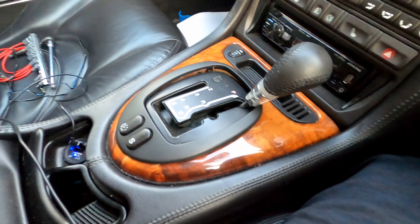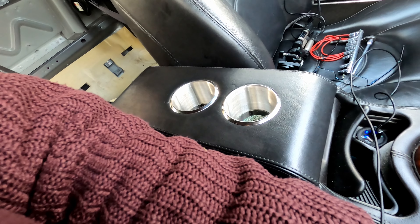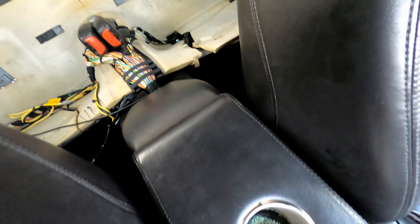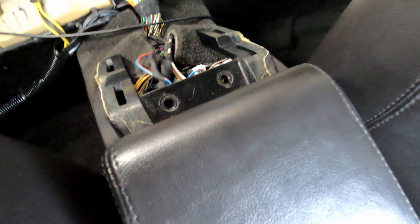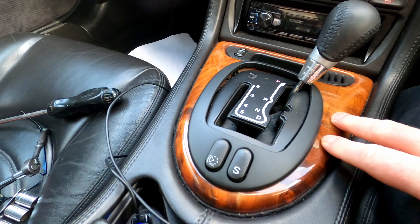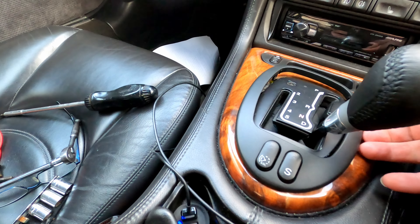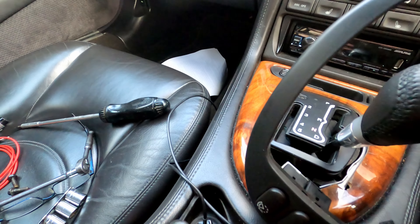The first thing you need to do is remove the centre console — I have shown this before in another video but I will show it again. So the first thing is to just remove the cover plate at the back here. That's easy to do, it just pulls off. That exposes two screws, so I'll take those out. The next thing is to take the assembly off here. It's always easier if you just get the gear stick out of the way. This is sitting up so it's already unclipped — I'll investigate that further. That comes up and out of the way.